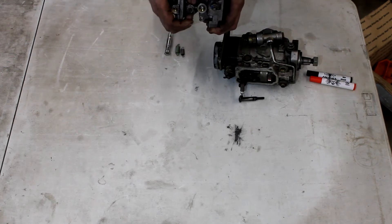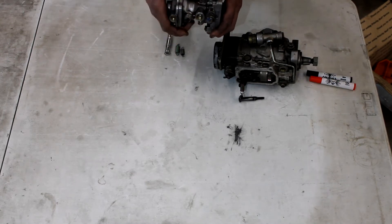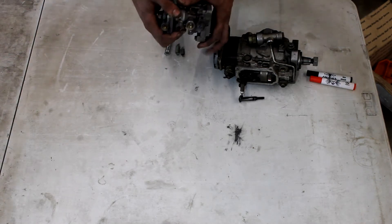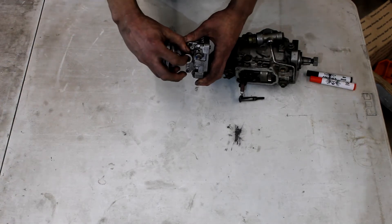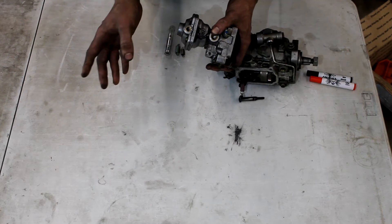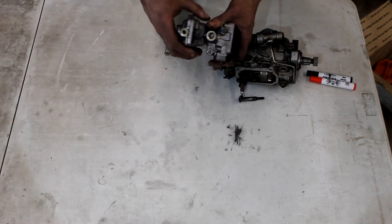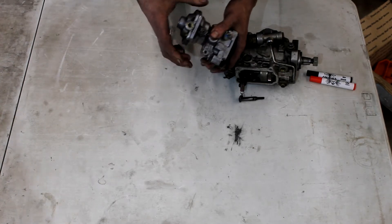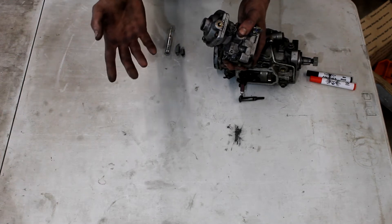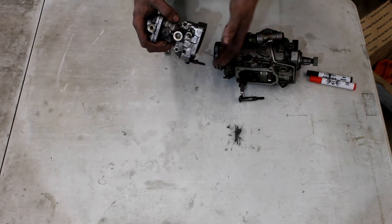For the diaphragm to compress down, this bleeds out any extra pressure. There should not be fuel coming out of this. If you have fuel coming out of this, you probably have a faulty return valve, which is allowing the fuel level to get up higher than this port. The return valve on these pumps is extremely important - you cannot switch it out with any other banjo-sized return valve. They have an internal assembly designed to hold a certain pressure while also bleeding off the proper amount. We learned this by trying a higher-flow banjo with a big lift pump, and the truck would not rev smoothly above about 3,000 to 3,400 RPMs. As soon as we put the OEM valve back in, the truck ran fine all the way up to 4,400.